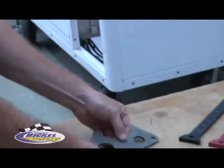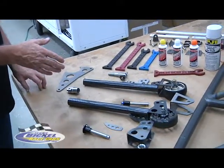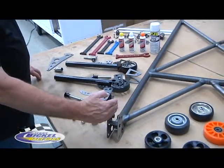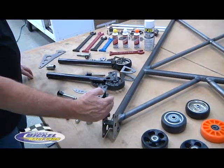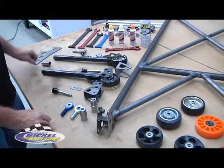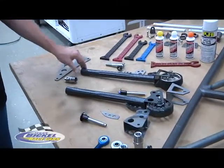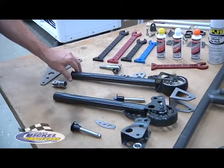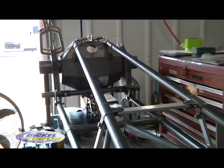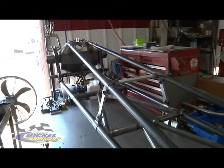On this particular bar, the upper bars do have to run parallel to the lower mainframe, while you don't have rod ends to give you any pivot or angle location differences. You pretty well have to run this bar with the upper bar again parallel to the lower mainframe. So this is real popular in maybe like 50, 60, and 70-inch length bars. Our Pro wheelie bars go anywhere from 60, 66, 72, and 80-inch bars plus.